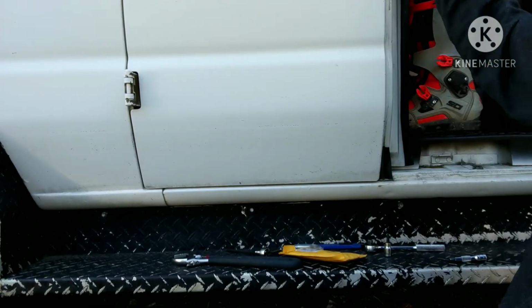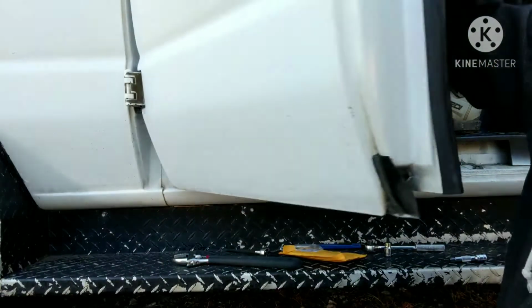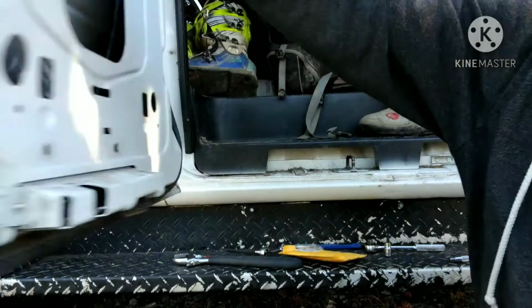And there we go. No problem. So that's all there is to it, guys. It's pretty simple. You can get those online, from Amazon, from eBay, anywhere. They're relatively inexpensive. I don't remember how much they cost. I'll put a link if I find one on Amazon for you guys. But it's real simple to put them in. These are common to break. They just get dry and brittle, and the plastic OEM ones on the cables break, and you can't buy those separately. You have to buy a whole new cable. So buying these ends is the perfect solution for it. Get all your doors working again.